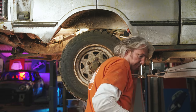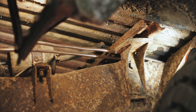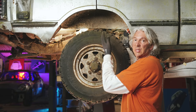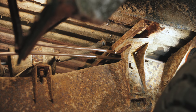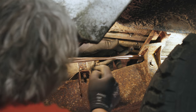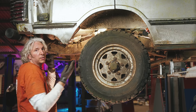Giving myself a bit more room — going to the front I can see where that bend is going to start. I've got my bend-position tape in the right place to go up into the engine bay, which means the pipes are now in the right position to work out where I need to cut them, ready for the fuel filter connection and the return that goes into the tank. That pinch-point clip is holding the pipes quite nicely. Now I can mark out where each pipe needs to go — one to the fuel filter, the other for the return — and then pull the piping along to give myself space to bend the front end all the way up into the engine bay.